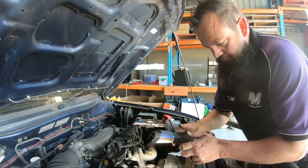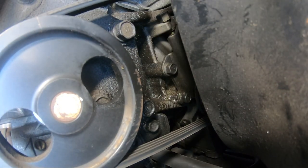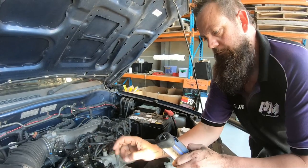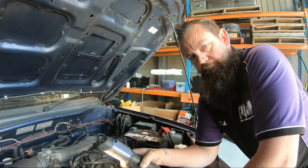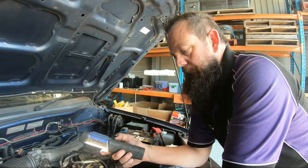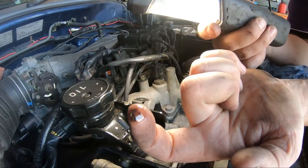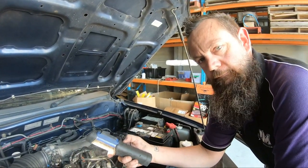One thing I've noticed straight away — see this shiny black stuff in here? That's oil residue from a component. Right above that is the power steering pump, and there's a chance it's leaking down through the front of this motor — that would need to be rectified by a mechanic. But don't go replacing any parts just because it looks oily. Degrease the area, run your car, and make sure that spot is exactly where the oil is coming from. The oil fill cap is right above the power steering pump, and it looks like someone has spilt oil there, which could be why it's oily underneath that area. Always double-check that the component you think is leaking is actually the source.